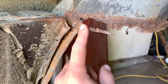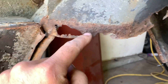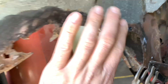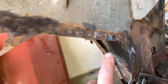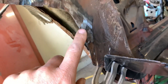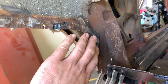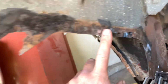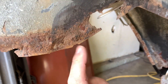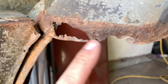Here's the thing we're going to try to fix up — this is what should be the inner fender well. The trunk floor will actually weld to this seam right through here. As you can tell, we've got a little rust damage. This is the worst side; the passenger side is not nearly as bad off, and there are even some rust holes here. By the time I get up here, though, it's in really nice shape. So I'm going to do a little patch panel from about here to here, going to about where that little notch is, and I'll probably end up replacing this pretty rusty section — just make a piece all the way around.